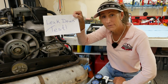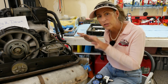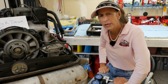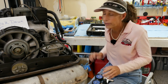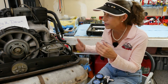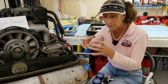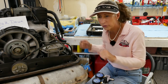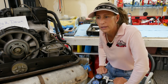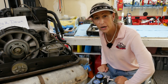I do not want to forget to do a leak down test. The leak down test should be done when the engine is warm, but of course I can't really do that. Some of you might ask why didn't you do a compression test? I'm not a big fan of compression tests because there are just too many variables. If the engine isn't spinning exactly the same speed for each cylinder you can get different readings, and if the throttle body or carburetors aren't open all the way, that can affect the reading as well. It just doesn't really tell you much — it just tells you what the engine can produce in the way of compression.